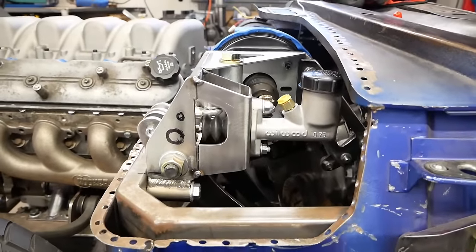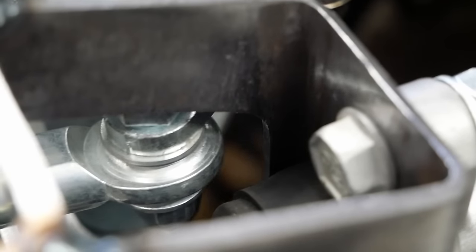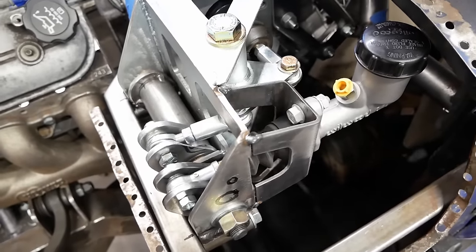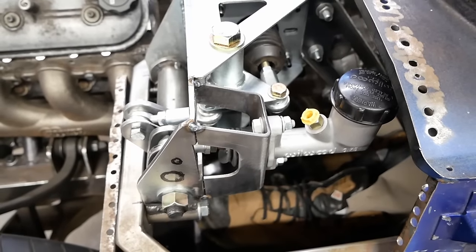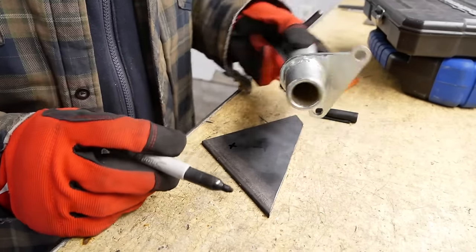This still needs final welding, obviously, but so does a whole heap of other stuff, so don't worry. We next need to finalize the mounting system for all this awesomeness, plus double shear the bell crank, as all the multiplied brake forces are going through it, and it would be daft of us to have beefed up everywhere else, but ignore this.